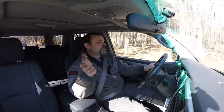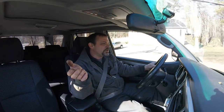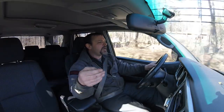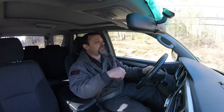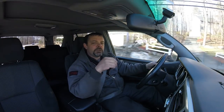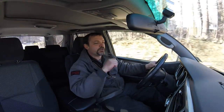So the trouble with this truck, it went to a Toyota dealer and they diagnosed it as a head gasket between cylinder 4 and a coolant jacket had failed. Coolant was bypassing the gasket and filling up the cylinder. The test that the Toyota tech had done was to pressurize the cooling system with a coolant system pressure tester and leave it all night with the tester on it, and sure enough, cylinder 4 had a puddle of coolant in the morning.